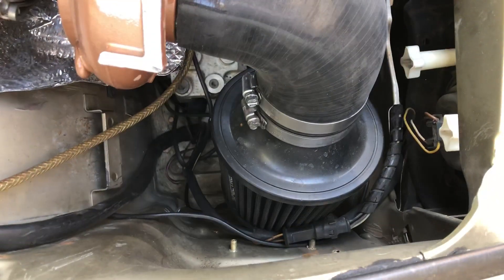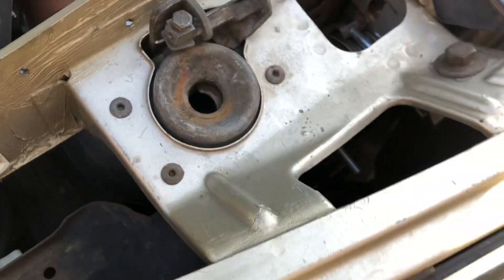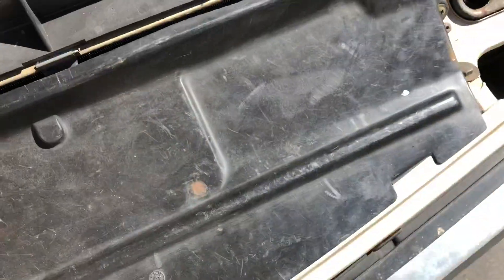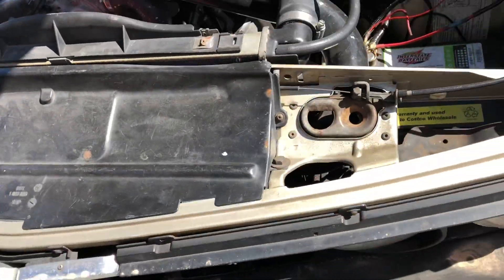There's a 4-to-3 inch elbow that just barely fit in there — I got that off Amazon for maybe $20. I came out 2.75 to 2.5 and then down inside is my intercooler — 21 by 18 by 3 inches deep. It just sits in there; I made a little mount for it and it fits really well. You do have to trim the back of the headlight housings a little bit and cut the top mount off. So yeah, about a $100 intercooler.